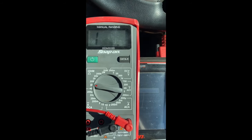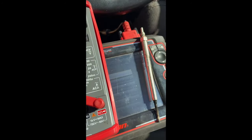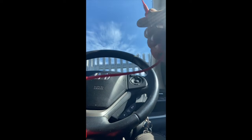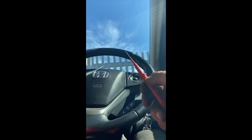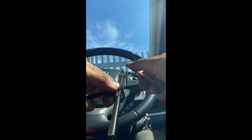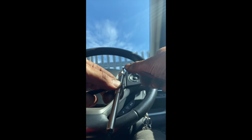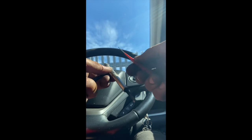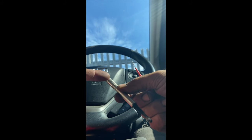So you get your multimeter, you want to set it on the continuity setting, which is that one there. It's a really simple test. Just try and mount the camera up. You've got your 2 probes, and basically they make a noise to say that there's circuit running through them. And then all you want to do is put one on the thread of your glow plug, and then one on the post there, and you can see there's no continuity through that, no resistance through it at all. That's why it's not making a bleep. Put it directly to it, there is. So that's saying that glow plug's completely open circuit, there's no feed through it, so it's not going to work at all. That's it.